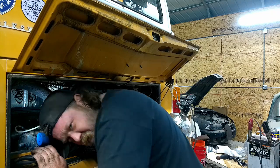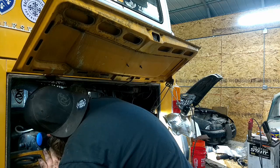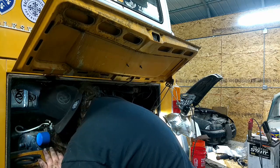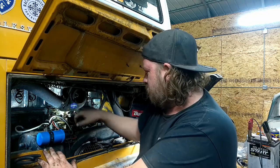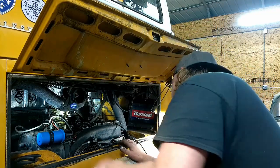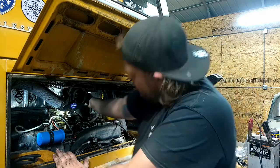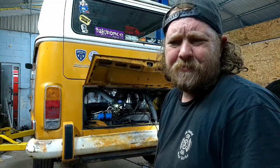All right. Also, I wish there was the access hole up top. It would have made life a lot easier. These wires are run really, really janky. All right, let me kick the key on for a few seconds. Let that choke hopefully warm up and actuate. I'm gonna leave the air filter on, but let me just leave this key on, and hopefully that clears up the rich scenario, because it is bad, and that kind of makes a lot of sense.